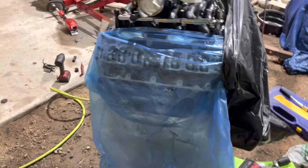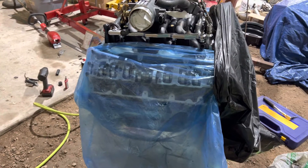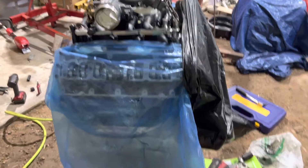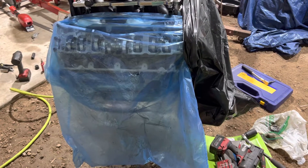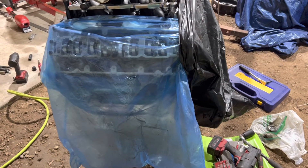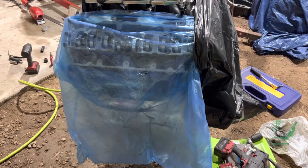I need to get a degree wheel and degree the cams. I do not have adjustable cam gears — if you get these cams, I would say buy them. I went and got an AutoZone timing set, trying to make one good set out of two bad ones, and just bought a new set. I put on a Cloyes set, which is a decent set.